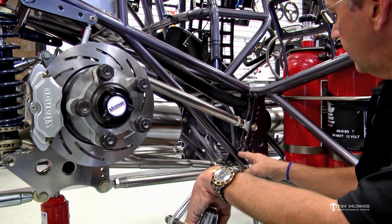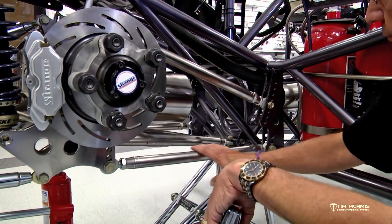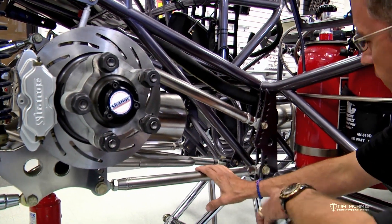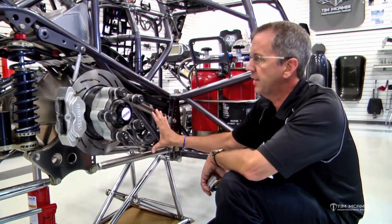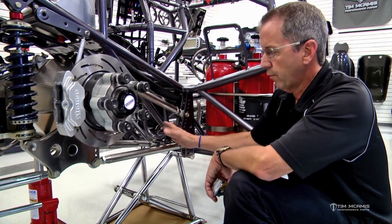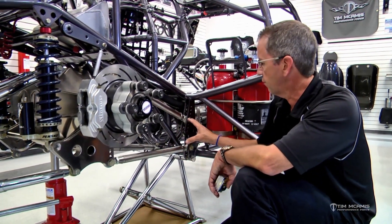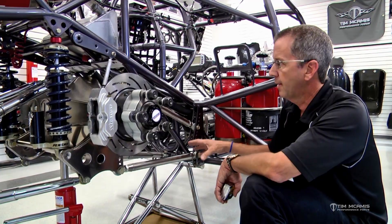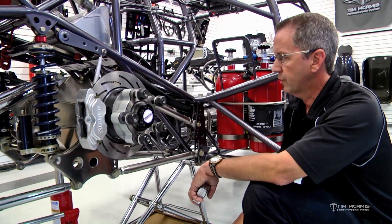You have your spread, your intersect point, and the angle of the bottom bar — that is critical in making the car work properly. Depending on the weight of the car, the power it has, the gear ratio on the transmission, there are many things that factor into this, but the very basics of a four-link are simple. We use a program called Chassis Master — it's very easy to input the numbers and plot changes for the four-link. But if you don't have that program, you can draw this out on a piece of cardboard long enough to get a 60-inch intersect point.